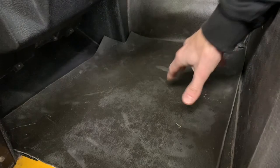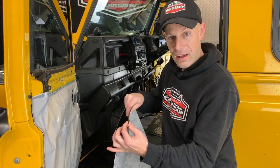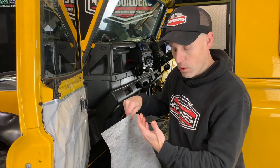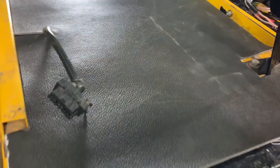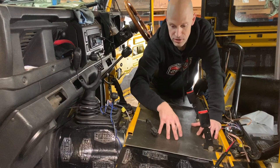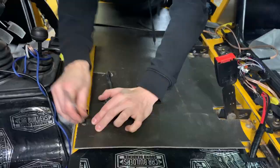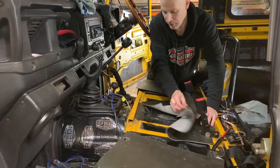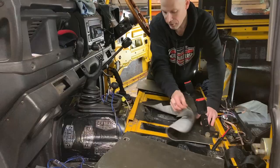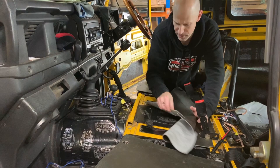Our next stage was to put a mass-loaded vinyl - it's a heavyweight sound blanket, this version is 2mm thick, weighs 4 kilograms per square metre, and you can see it's got a material scrim face on the back which allows us to put glue to it. We're going to put it over here as a blanket to stop that transmission noise. Packaging's tight - I would prefer to put a closed cell foam as a decoupling layer under it, but the seat rail and the rubber floor coating leave no room. So we're going to put this straight down. Here I'm picking up the seat mount points - I've picked the centre of the hole with a punch to make a nice bigger hole through it. I've kept it tight around this wiring loom here with a keyhole slot. That grommet actually wasn't plugged in, which means you're going to get noise and heat come up through there, so we've made sure that grommet's all tight and we've done a keyhole here to keep it pretty tight.